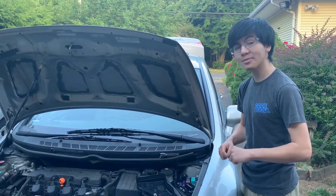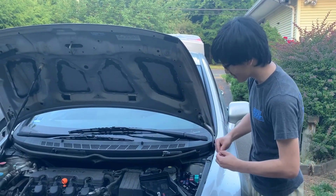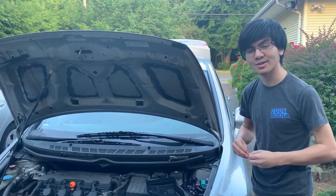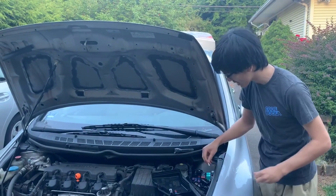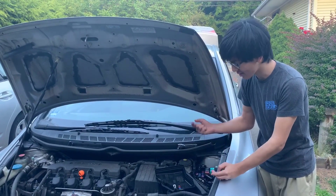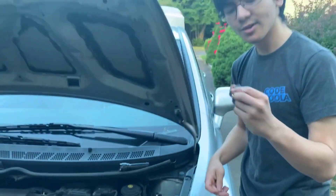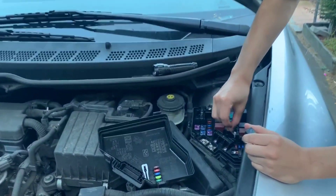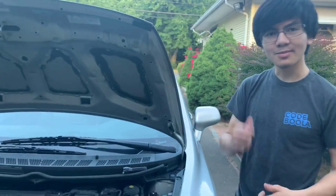Another thing you want to do is make sure the fuse is actually okay, because you want to diagnose the problem. A good way to do it is to take the relay and shake it to see if there are any broken parts. If that doesn't work, the good way is to swap it out for another relay — swap it out and see if it works, then you'll know if your fuse or relay is bad. Now we have the gold pins blocked off, and we're going to deal with the copper pins.